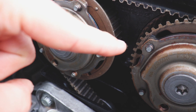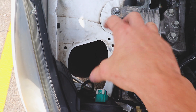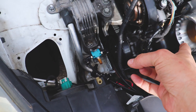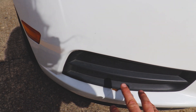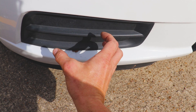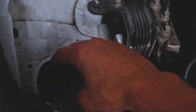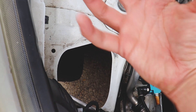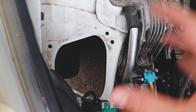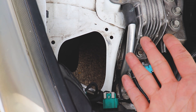One of the things I want to do is build a shield once I upgrade the size of the intake tubing going to the turbo. We have this hole that leads right here, and I'm thinking we can get a fog light and put a duct that will push some cooler air into this area. That way, with the shield in place, we'll have cool air being pushed towards the intake and can get the intake air temps down, because they have been a little warm.